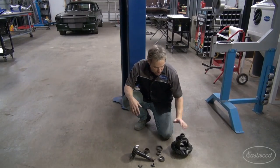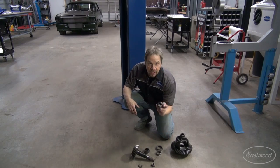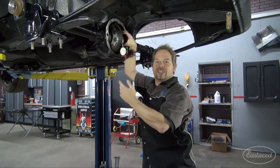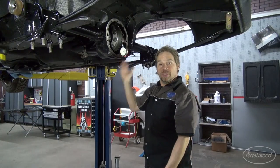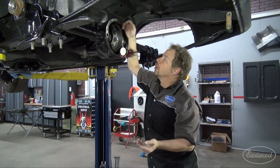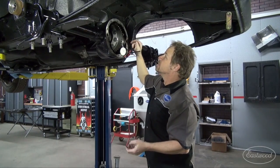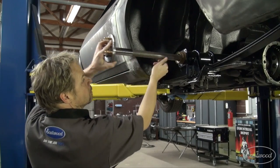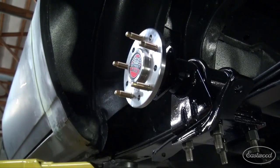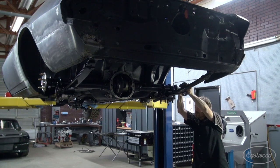Before you begin this project, keep in mind that your old parts are actually useful until you get the axle sealed up — they become tools, especially in the case of the side bearing. Don't throw anything away until you're done. The TrueTrack differential is in, everything's shimmed properly, we've got a great wear pattern, pinion depth is correct, and we've got between 6 and 10 thousandths clearance on the ring gear and pinion — just enough to allow oil to circulate. The new Moser street axles are an upgrade from 28 to 31 splines, which combined with all the other upgrades will seriously improve the strength of the rear axle assembly and the overall performance of the car.